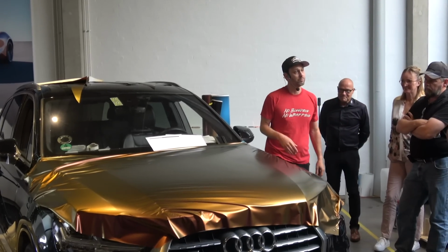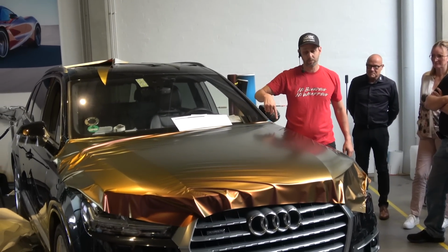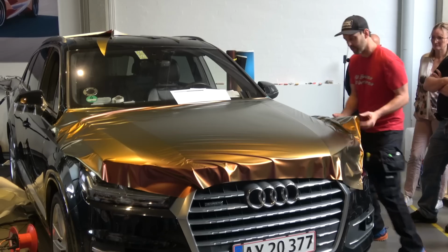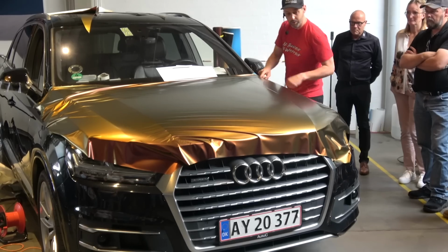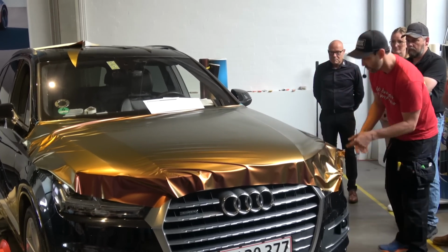What does the material tell me? Okay, you've got to read your wrinkles right now. Where does the material want to go? It wants to go here. It's pointing right here. Point, point, point, point. I want to come here, so that tells me to pull where? I'll come back here, pick it up and pull this way. I'll pull back up to here, and what do I have? Glass. Cool.